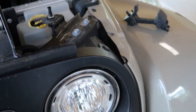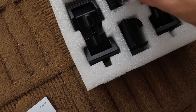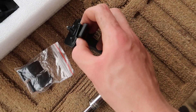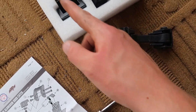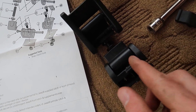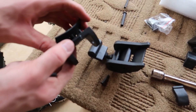The nuts we're going to use for the install actually come with the hood latches. Here are the hood latches we are installing — they're the Rugged Ridge aluminum XHD hood catches, all powder coated black. In the new ones they actually send these parts with them; in the older version of these hood latches you had to remove this part from the OEM hood latch. Now they send them with the hood latches, so just take the new ones out and put them on. To take the bottom bracket off so you can install it without it flopping around, you have to undo these two 5 millimeter Allen bolts on either side.